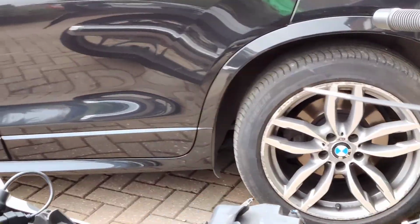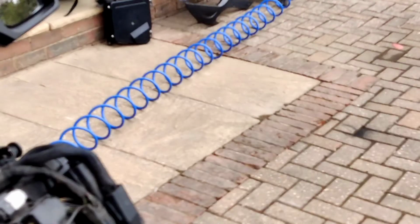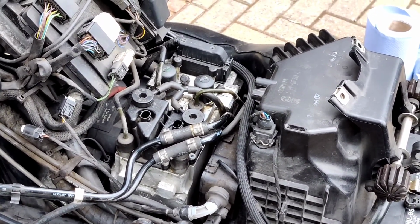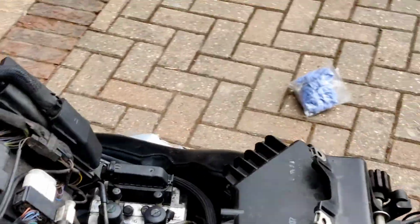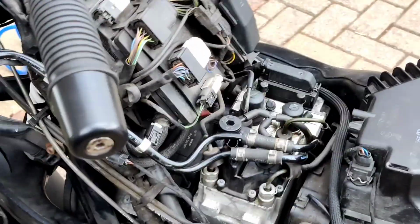So now it's left to remove the ABS and do the wiring part of it, because although it's physically disconnected from the brakes now, you need the speed sensor and the brake lights to work, which need wiring from the ABS to remain. I'm going to remove the actual physical brake lines now to get them out of the way.